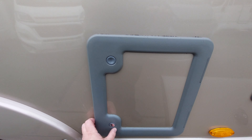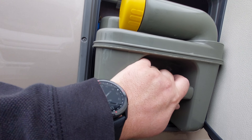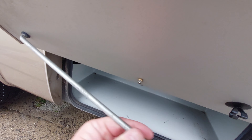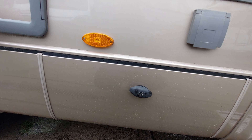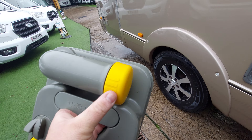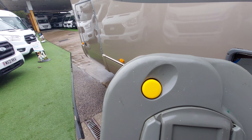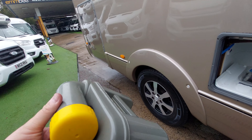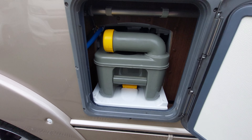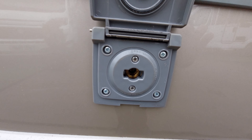In front of the rear wheel you'll see there's a toilet cassette just there. To remove it, lift up the little yellow lever and slide it out. Use the stanchion because with that up you won't get your toilet cassette out. So lift it up and slide it out — there's a little handle to lift it with. You've got to remove the orange cap, lift it up, and if you press the little yellow button at the top that will allow it to flow out of the toilet cassette easier. When you finish cleaning it, put your chemicals back in, slide it back in, and make sure you hear the click — that means it's secured in position and you can use the toilet inside.